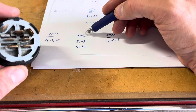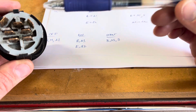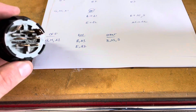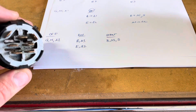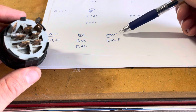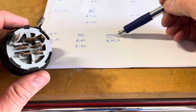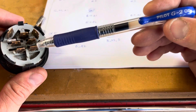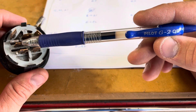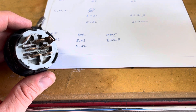When we're in the run position, we have the battery terminal connected to A1, and the E terminal connected to A2. I didn't dig into exactly why that is, so forgive me — I couldn't find the right wiring diagram for my machine. In the start position, we have the B terminal also connected to A1 and also connected to S for start, because we need the starter motor to get everything going.